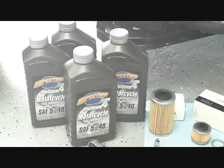If you're out on the open road doing mainly highways, you may be able to get about five thousand miles out of the oil. However, oils are still subject to thermal breakdown in city driving, so no matter the quality of the oil, we definitely recommend changing it about every three thousand miles if you're doing city or in-town driving.